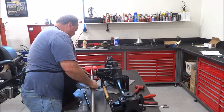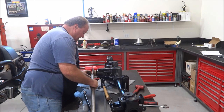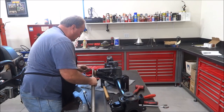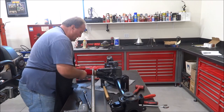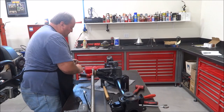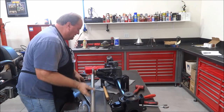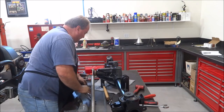When you get down to the last little bit, the crush sleeve actually crushes a little easier, because you've already taken that crush sleeve and bulged it a little bit. That initial set is what takes the majority of the pressure that you're putting on. Once you get to that point, usually a long ratchet or a breaker bar will allow you to creep up the last little bit.